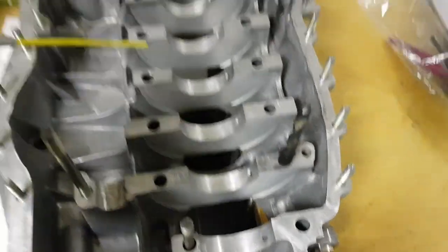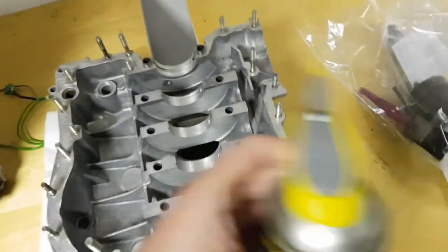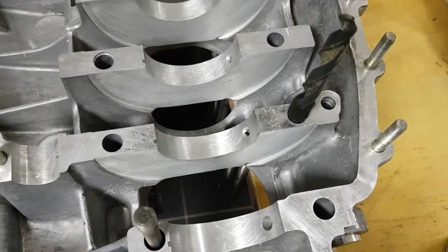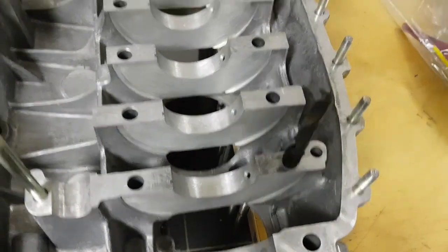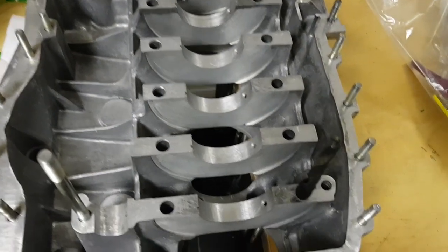To test it, I'm just going to fill it up with a little bit of fast-release penetrant and then put some compressed air through it and make sure that it's squirting out. I'll then repeat that for each of the three in this half of the block and then move on to the other half, which is slightly different.